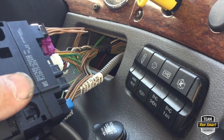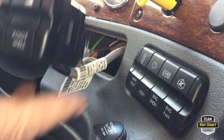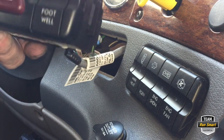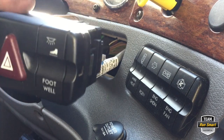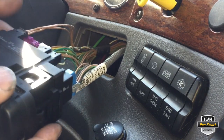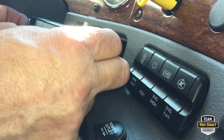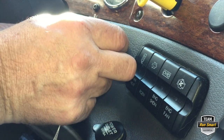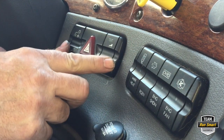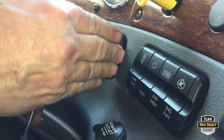I got those tabs and the switch just popped right out — pretty simple. You can see it's just got some pins that slide up into the bottom of the switch. It can only go in one way — pushes in, snaps in — and now we have the dash light switch working properly. When you go to put it back in, just make sure both of these releases are all the way up, fit it back into its spot, and there it is locked in.